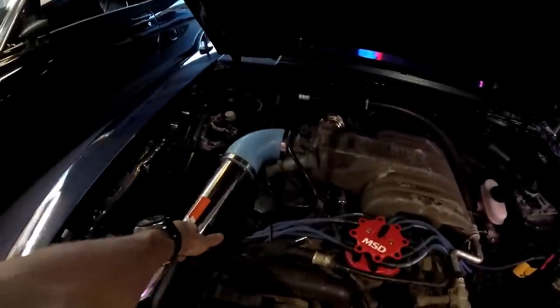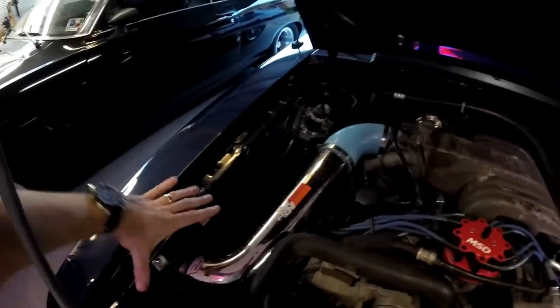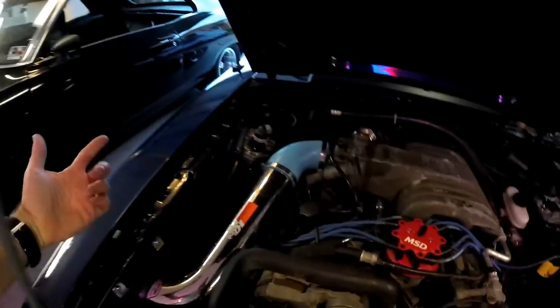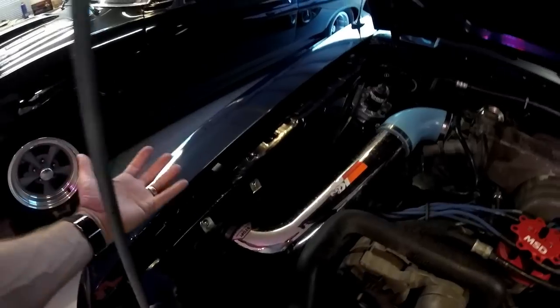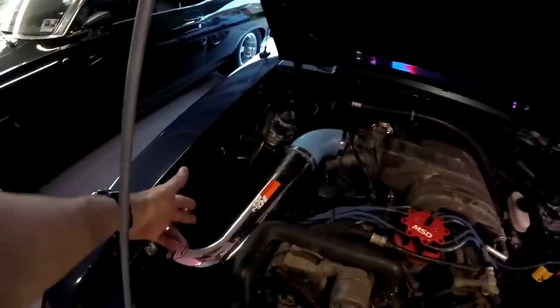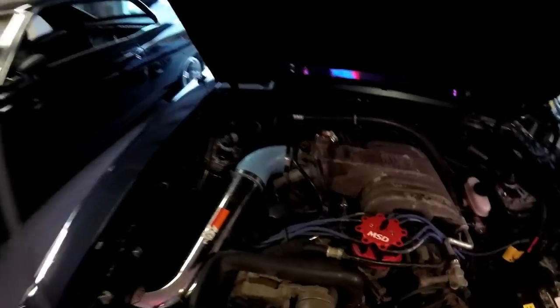I got this MAC Products cold air intake for about half the price new. The filter is quite large and it's pretty simple to install - you just remove the inner fender bolt, the plate at its stock location, remove the rubber mounts, and the filter goes on from the bottom. Put the inner fender back on and that's really it.